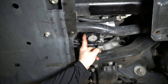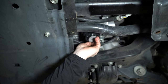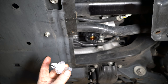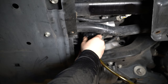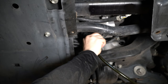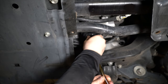The oil filter is in this housing up here. First step, we're going to take this drain cap off — it's just a 3/8 socket recess — and that spins off. You can see a little bit of oil come out. The factory oil filter comes with a plastic widget that you shove up in there to drain the oil. I've got an adapter from Snap-On that has a hose to help me not make as much of a mess. Thread that up in there and let the oil drain out.